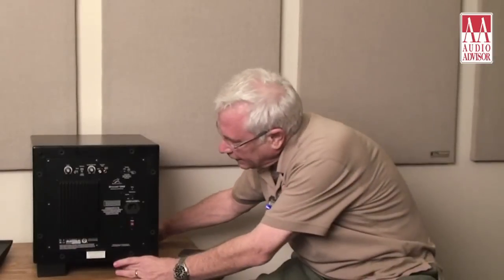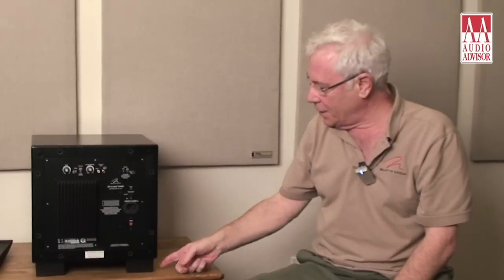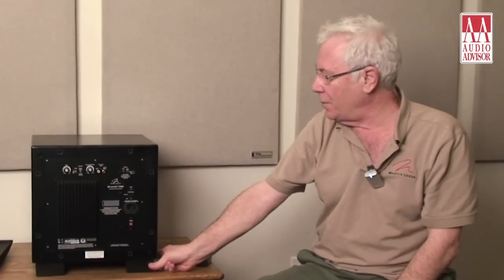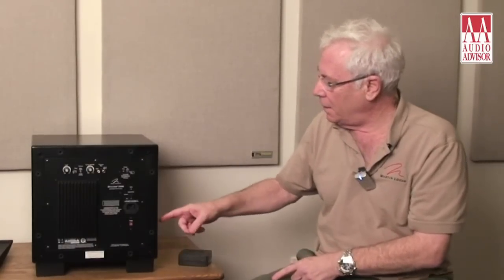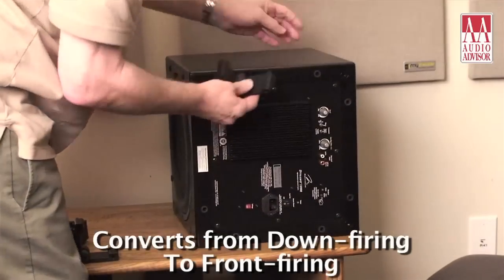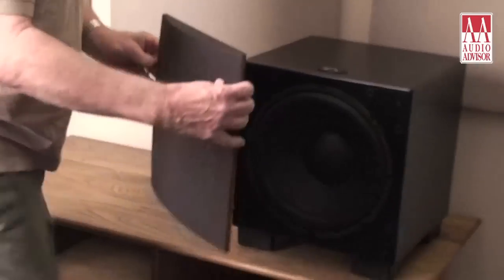One of the coolest features — you notice these lovely legs here. You haven't seen the actual woofer driver anywhere because it's firing down. These come equipped with feet, and if you have a carpeted floor and you want to get the best sound, the tightest performance, the least vibrations in the cabinet — which is a very well-braced product to begin with — you add our specialty ETC high-quality spikes. We have something also unique here. This is the grill. Why do you need a grill if the sub is firing down? That's because we remove these feet and place them here, flip the sub, and the sub becomes a front-firing device. It's very useful for situations such as built-in cabinetry.